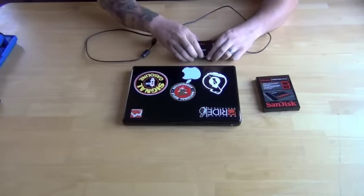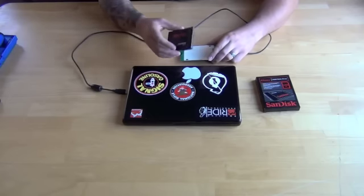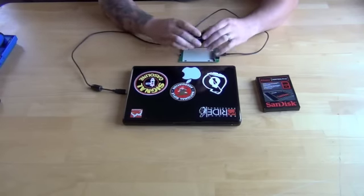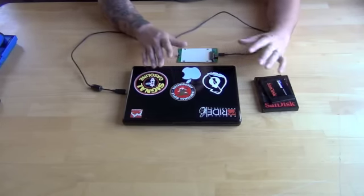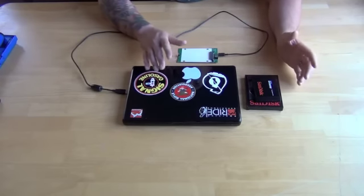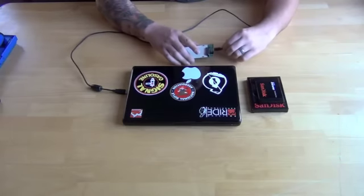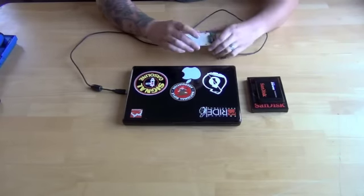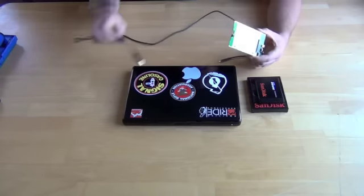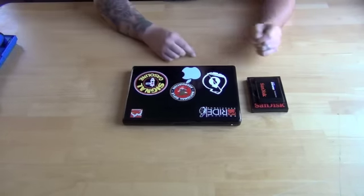So with this guy here, basically what you're gonna wanna do is get your caddy, put the SSD on the unit, plug it into the existing laptop, and then format this drive. In my mind, it's making it a bit easier. Most of the time the system will take the empty drive, format it to work with that system, and then move forward with it. But for me, I like to make it a bit quicker, less problems. I know that it's gonna run. So I use an external caddy to format the hard drive to whatever platform it is that I need to put it into, all right?